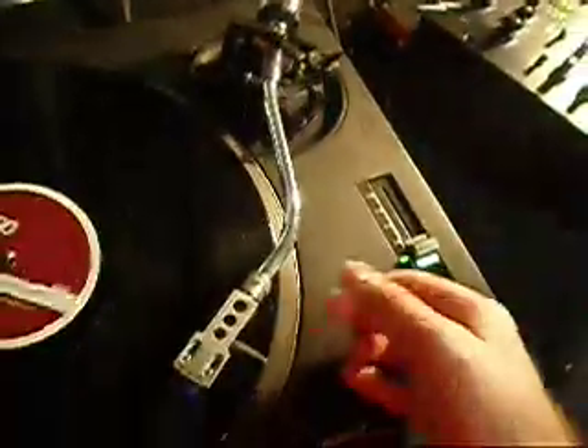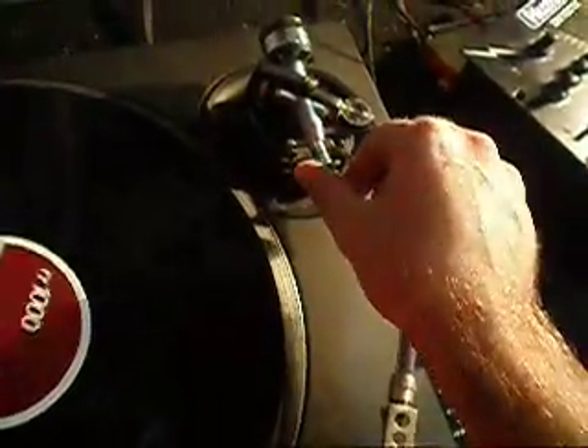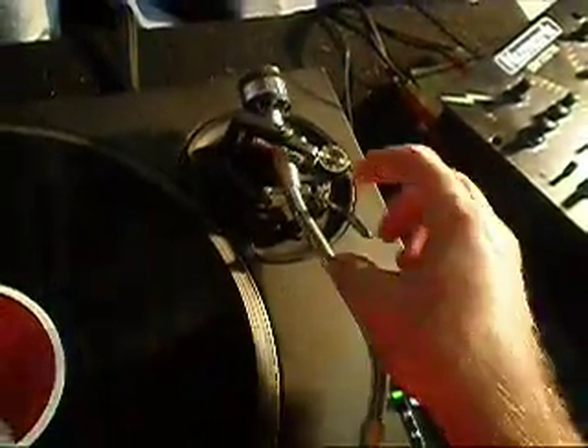The tonearm is working fine. The tonearm clip clips it into place — that's working fine. The tonearm itself raises and lowers no problem, and it locks into place. If I run my finger and thumb gently against the arm there's no give in the axles, which shows that the screws are calibrated correctly and the bearings are in good condition.